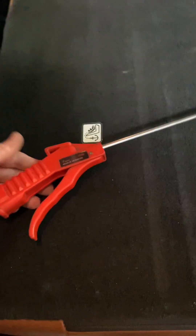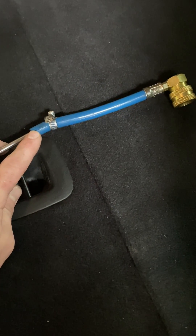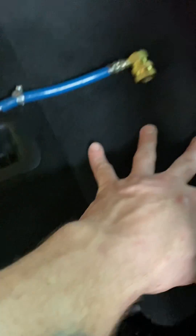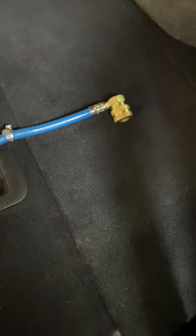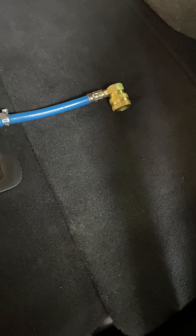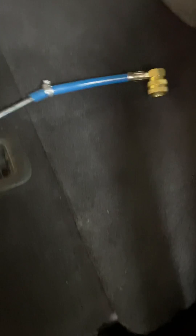What I've done is take an air gun and an R134a quick connect for one of the small cans — I cut it and hose-clamp it on there. When we do this, we can pump compressor air into our tank. By itself, our compressor will not actually pressurize the tank to where the system needs it — I think it needs to be around 200 psi.